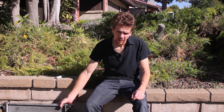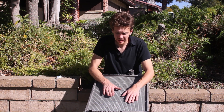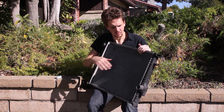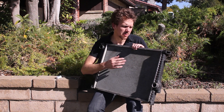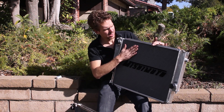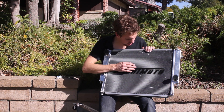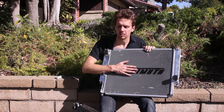Another key difference between the stock BMW radiator and the Mishimoto that I really like is the core. If you look at the OEM radiator, the actual radiator section is thinner — there's a good maybe three-eighths of an inch inset right there. The Mishimoto doesn't have that; the fins take up the entire section. The only thing I don't like is that the little fins seem very thin and flimsy, a little bit shoddy. But other than that, it looks like it'll be a really good upgrade.